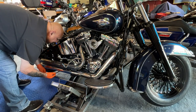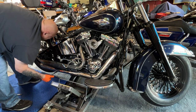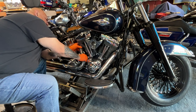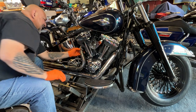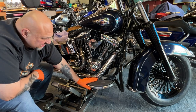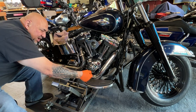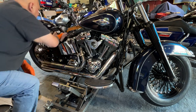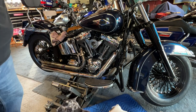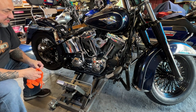Now I'm going to take these guys off down here. It's going to work out better because this would have still been in my way. It really saves a lot of time. Get your mounting brackets off like that. This foot board might be a problem in getting this one off. So I'm going to loosen the one in the back and take the rear off, and I'm going to just loosen the front. Because this bracket right here keeps this from rocking down and being able to pull it out. I'm going to take the foot board off. I had to take the front exhaust off and then disconnect the O2 sensors from the front and from the back.